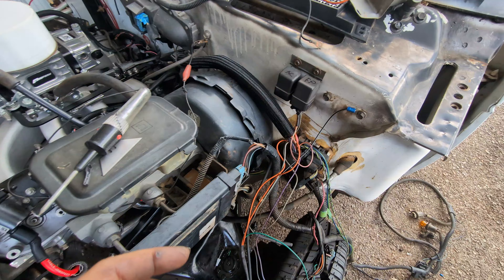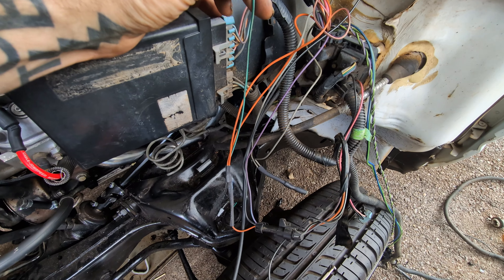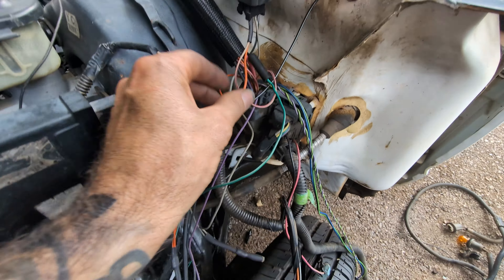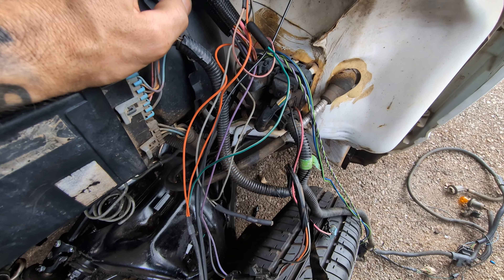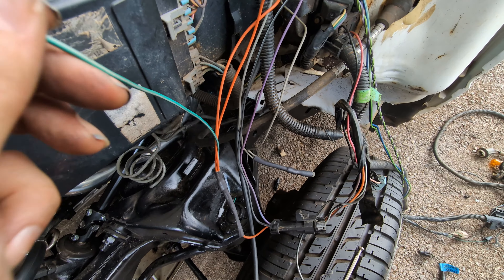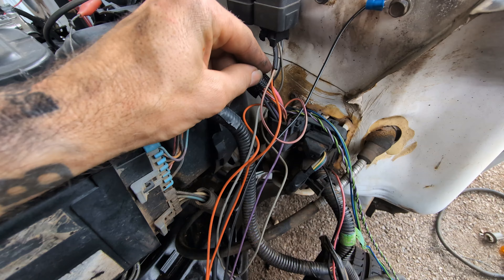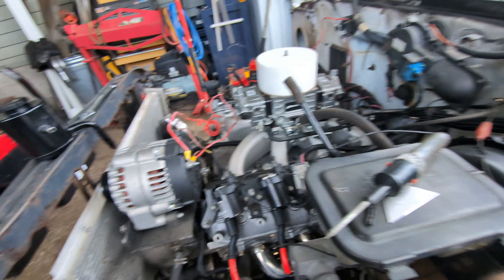Where I screwed up: I said in my last video that this green and white wire that went to the ECM, I said to hook it to these orange wires, which were power. The orange wires power a bunch of stuff, but one of them is the fuel pump relay, which is right here, and I want to keep this relay. The issue is it turns out this orange wire is constant power — it's not key-on power. So by having the green and white wire hooked to it and into the relay, you end up with constant fuel pump power, which is a problem — you don't want that.